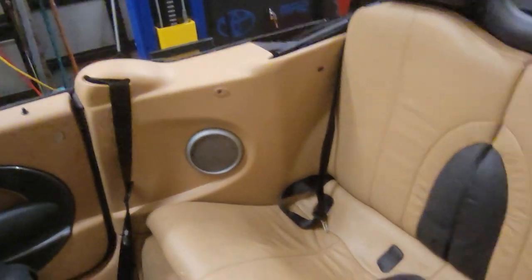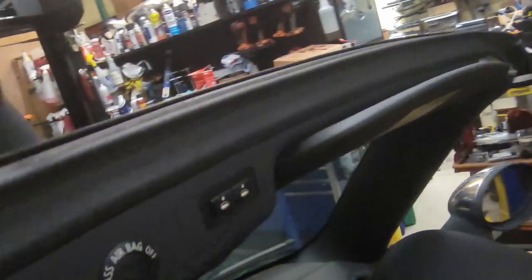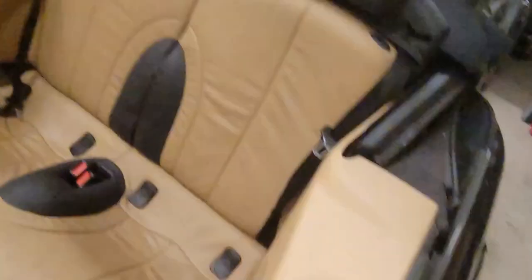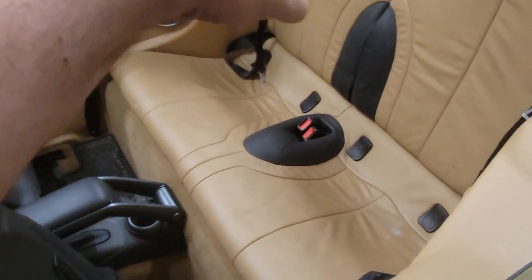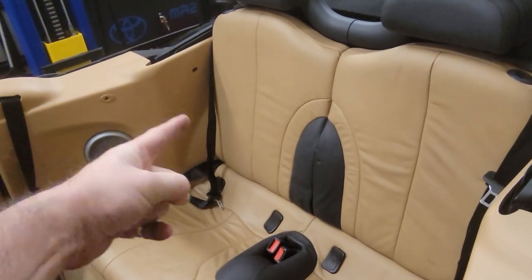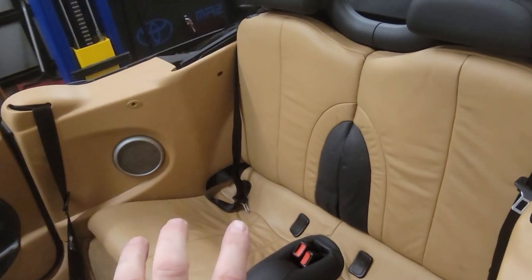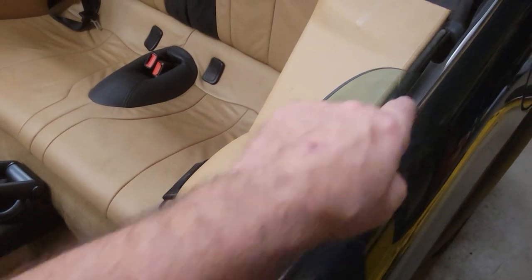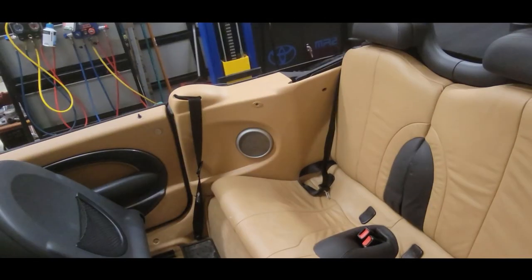Let me just show you what we're dealing with here. Driver's side window — that one's stuck, it won't go up or down anymore with the button. The other one's all the way down but it won't go back up. Mini Cooper convertibles have an all-up, all-down button, and the back windows go up first then the front windows. Very crunchy — nothing's moving. Back seat's got to come out, back rest's got to come out. Then the panel comes off, and there's a window scrubber on this side that's got to come up and out. Three bolts hold this whole unit in — two on the top, one on the bottom — and we can slide this all out.